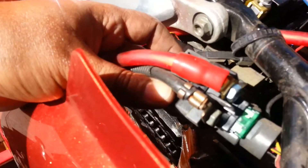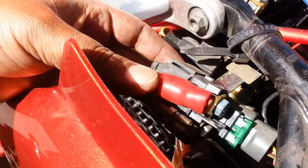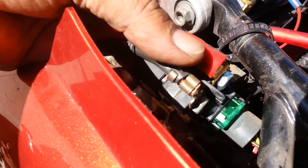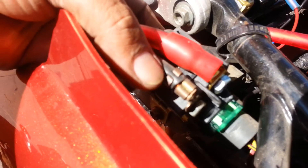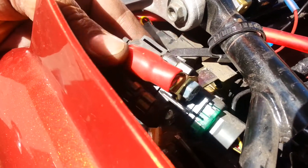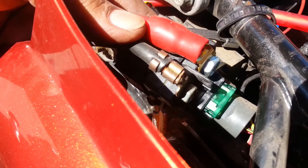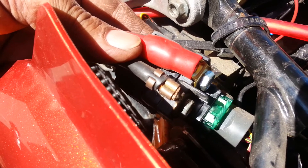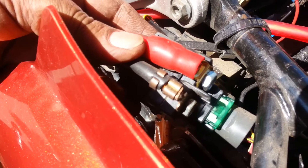Here's another precaution. Because the terminals are so close together, and the factory didn't have rubber covers on them, there were basically two exposed points. If for some reason they're not tight enough, or they bend, jiggle, or wiggle and make contact with each other, the starter's going to kick in. So if you're riding the bike, it might be a bad day for you.